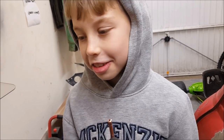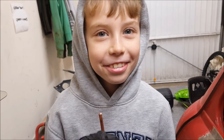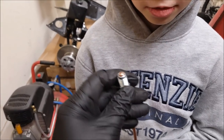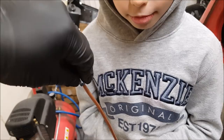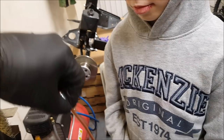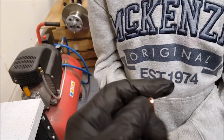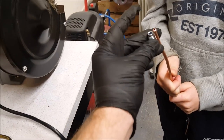Yeah. What? You put the thing on the end. No, you put the thing on the end. So look, here's the brake union, okay? This attaches to the other bits of the brake pipe. If that's attached to the other bit on here, and you pull that pipe downwards, what happens? Pull it down. That comes off, and you've no brakes because the brake fluid's gone everywhere. So flaring the end basically means to get a flare on this end to stop this coming off.